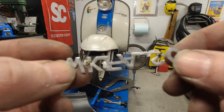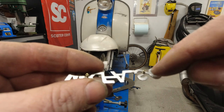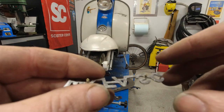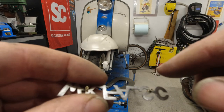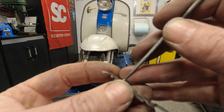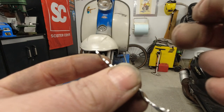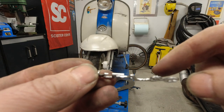Another really important thing: I've seen it suggested that you should drill the inside, because when these badges get chromed they can be a little bit brittle on the back side, and the brass won't peen over. That's not how I do them. It's so small — it's two millimeters — you'd probably have to run them through with a one and a half millimeter drill. I haven't got that steady overhand, so what I do is use this really small needle file and just give it some twists, because you don't really need to take the chrome off all the way down into the bottom of that tube — you're only peening over the end bit.